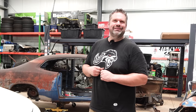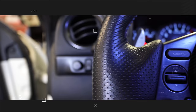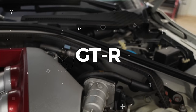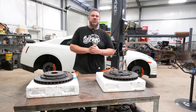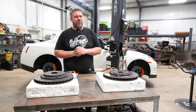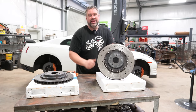Let's give it a little beauty montage and then we're going to show you those Corvette parts we're going to put on it. Welcome to the table of parts where we're going to show you what we're doing to the GT-R today — well, some of it. We've got some of the parts that we're just going to put on and talk about while we're doing it. The main thing that this GT-R needed was new brakes. If you look, these front rotors and rear rotors are extremely worn — you can see very heavy ridging.